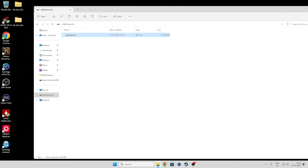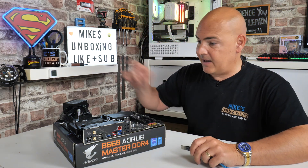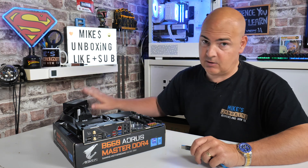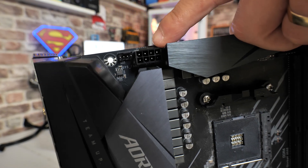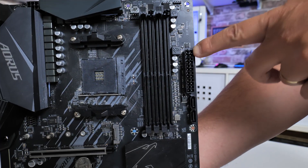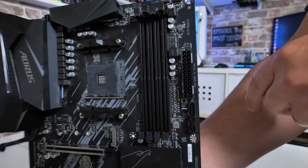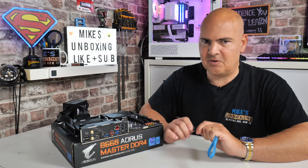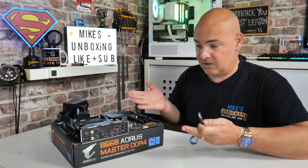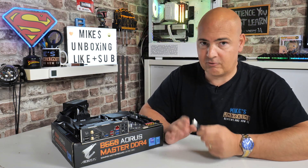Remove the drive from this computer to take it to your motherboard. The motherboard is on our box, the power supply is connected to mains but not switched on. The 8-pin EPS connector is plugged in at the top left and the 24-pin connector is also connected — make sure they're fully seated. A question I get asked a lot: do you need to rename the file? Yes, you do have to rename the file — otherwise your system will not recognize it and won't flash. That part is extremely important.